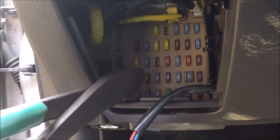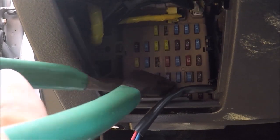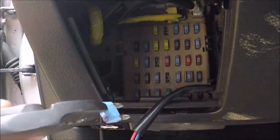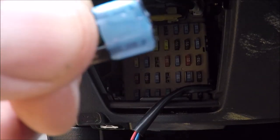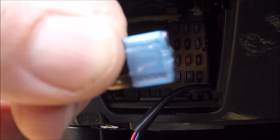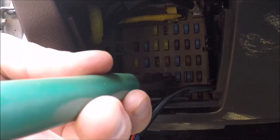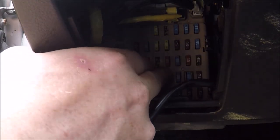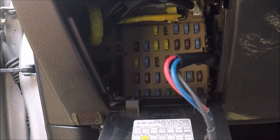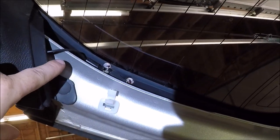So we'll go ahead and replace the fuse for the rear windshield wiper. Like I said, it was 4 over and 4 down. This 15 amp right here that I did black. Not sure if the camera could pick that up, but the very end of it is broken. So we'll grab our new one. Reinstall our cover, lining the bottom two up, clicking it in, pushing it up and clipping it shut. The wiper on delay and on.